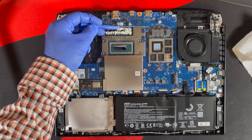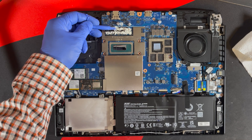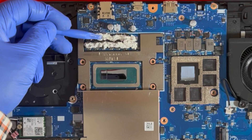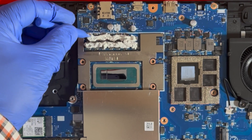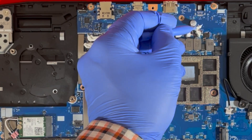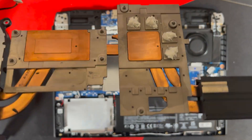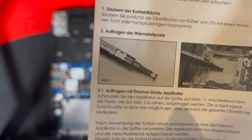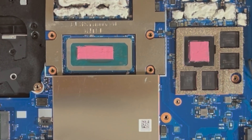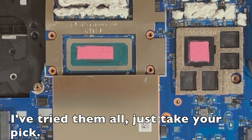I still have some K5 Pro and will be using it to replace the older pads. If I do this again, I will replace with regular thermal pads. I put some of the K5 Pro on the heat sink because I don't know how thick it should be. I used the Thermal Grizzly applicator to spread the thermal grease, and it will most likely be the last time I use it even though it came out alright. A simple line, X, or spread is just easier.